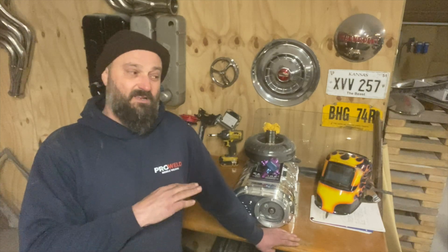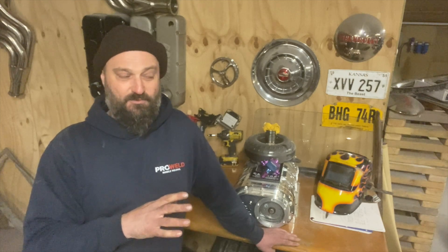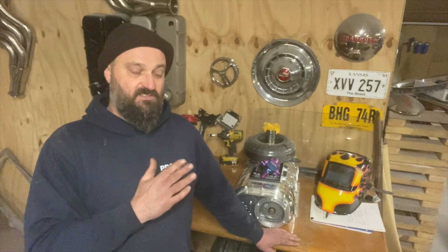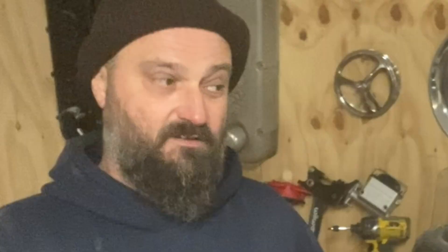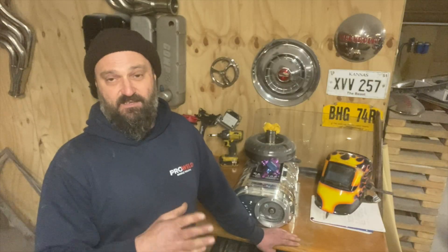We are in a little bit of a dilemma. I've had a think about this — we're putting an 850 cage in this car, and I don't know if that's the right thing to do. We've worked it out, and just on a thousand horsepower with the gearing and tyre size, if this thing hooks with a thousand horse, it's smack bang on 850 at 160 mile an hour. And obviously we've got a lot more than that. I think we should be shooting for a 750 cage, because there's no point having all that power if we're going to get kicked off the track for running too fast. Not sure if Wayne's got the time to do that yet — I'm going to sleep on it for a couple of days, have a chat with Wayne and see what he says.